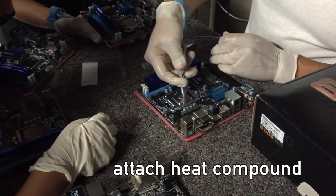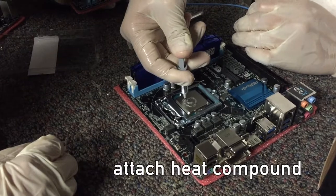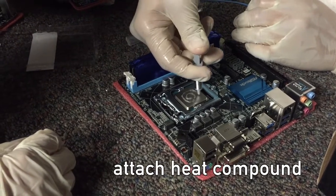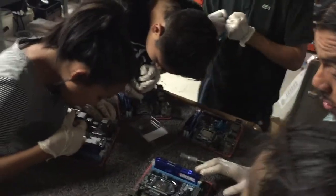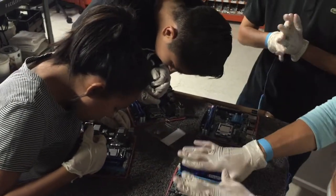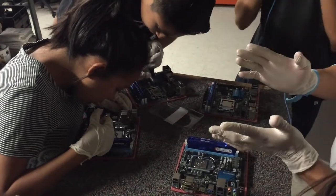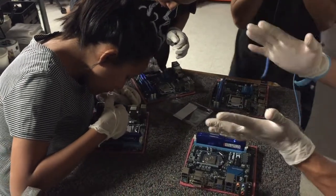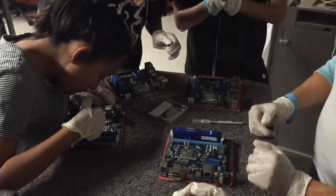So to transfer the heat to the fan, thermal paste is essential. No CPU can ever be mounted on a fan without this stuff. You don't want to put so much on that when you squeeze the fan on there it squishes out the sides — just like when you put too much jam on your bread and it squishes on the sides.